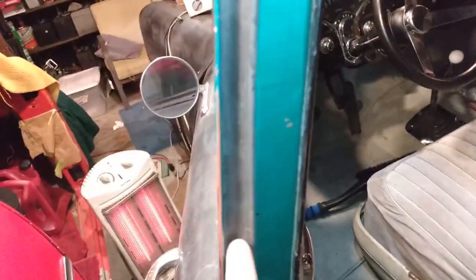I'll start the process on this and then finish this door tomorrow, and then the whole side will be done. The 3M weather stripping glue is kind of like contact cement — you apply it to one surface and then another and let them dry for a tiny bit, then you put them together. I started doing the weather stripping on the other side more methodically, doing two or three sections at a time, and it worked much better. You put it on both sides, let it dry for a second, then adhere it, and it seems to stick really, really well.